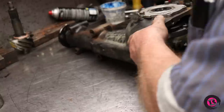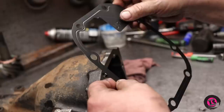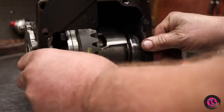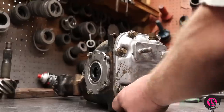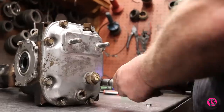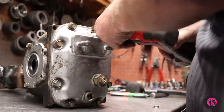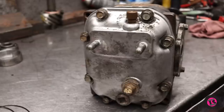Just like that — now put the rear cover on. This gasket has a built-in slinger; it says 'up' so you put that up to the right side. If you try to put it up to the left side it would hit the gear, so obviously that's not right. That's a nice metal gasket with a rib in it, so you don't need any sealer or anything. And we're done.